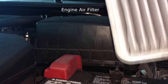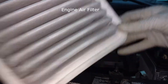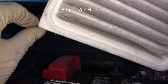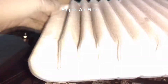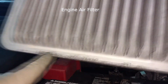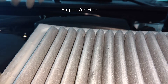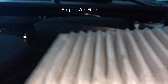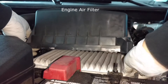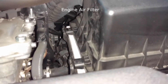If you don't remember which way to put this filter in — every side is round, you see here on these three sides it's round, but on this side it's square, it's a 90-degree angle — so that square side goes in the back. It goes like this, so it says 'Toyota' right here. Everything, the wording — this part goes in the back, in the top left corner.